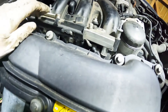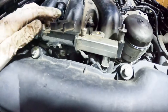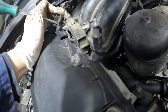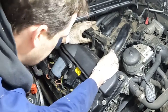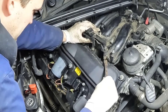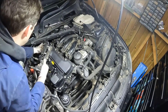I've got the retaining bracket out of the way. I'm now struggling to get the fuel rail up - we do have cable ties holding the wires in place here. Slid a screwdriver down the side and just gave it a gentle lever, and it has actually just popped off. I've got the injectors loose - the fuel rail with the injectors will come out together, but it needs a little gentle persuasion. Being careful not to lean on any plastic and crack it.